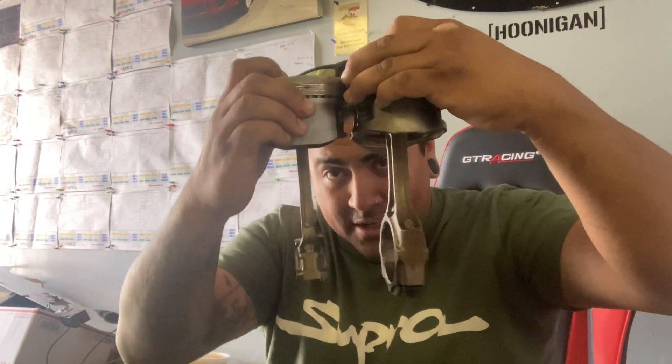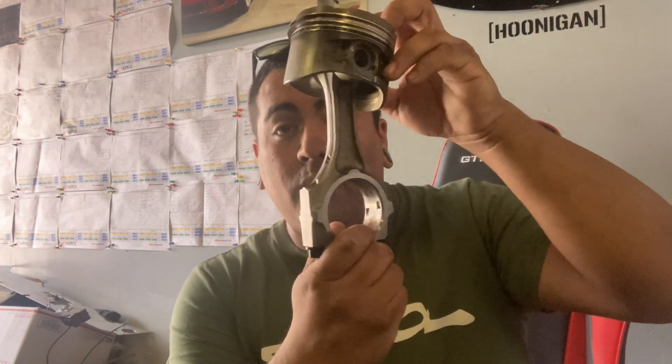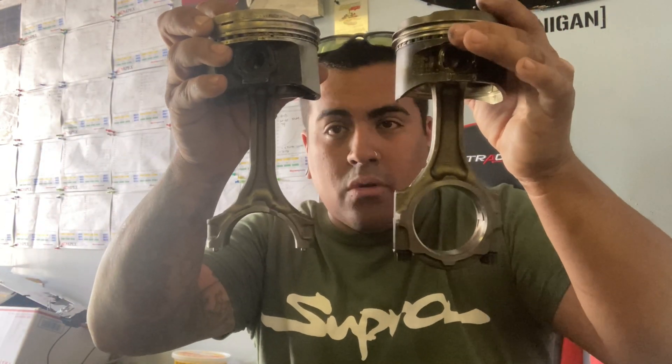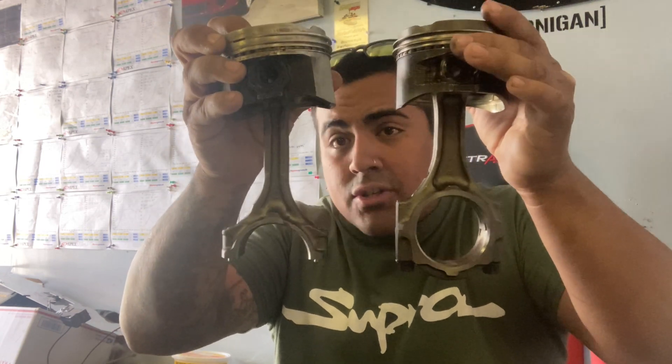Seeing this, you should know we're going to have to be like Honda guys. You really have to understand these will snap and start punching holes in the block and make a huge mess. So what it comes down to is yes, your 2JZ GE VVT-I engine or any of the GE engines will do what the 2JZ GTE does if you just put a real rod in these things. You could easily get to 600–700 horsepower by just swapping in GE non-VVT-I rods or putting in an aftermarket rod, which will be even better than both.